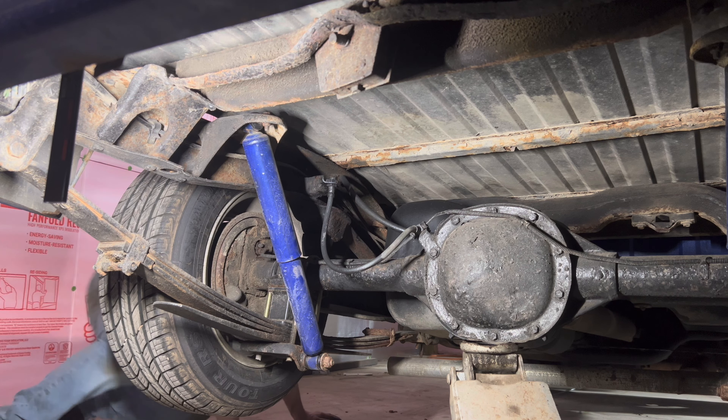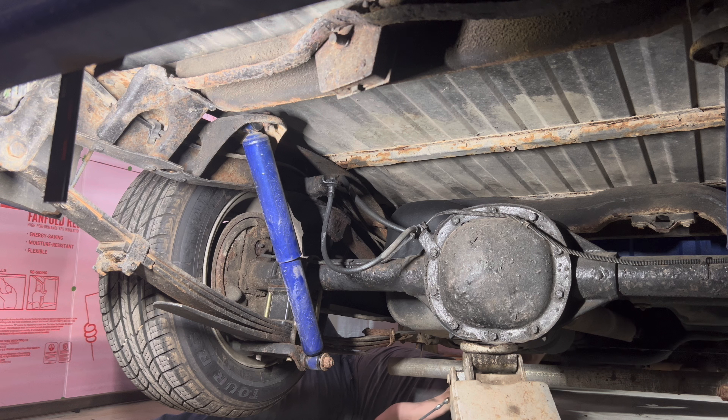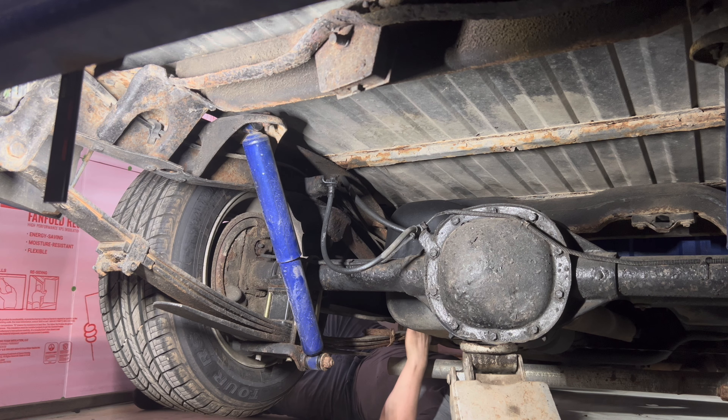Alright, so I ordered about 15 feet, which I knew I needed less than 15 feet. I've got two sticks of five. What you do is get a little union - I always use the two small ones here and then feed that down through your frame rail. That's about how long I need, plus or minus the little bends on each side, which on the frame rail would probably be up here anyway, so pretty close.